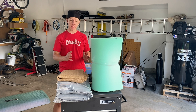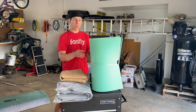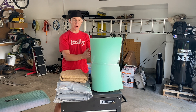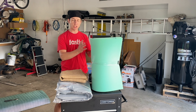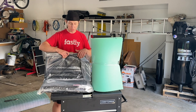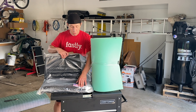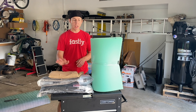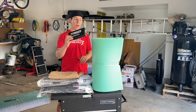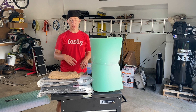Let's take a look at the items we have here. Just like the old one, we have burlap to lay over the spring frame, and we have our foam — this is two-inch thick foam and we're going to try to fit that underneath there. We'll pull and stretch to get that two-inch thick high-density foam under there. And then we have our actual seat cover — this is a black seat cover from PUI Interiors, part number 70CS10C2, the black vinyl rear seat cover. And then we have some hog ring pliers and hog rings. I'll have a link in the description with product information.